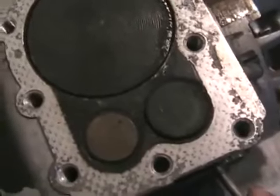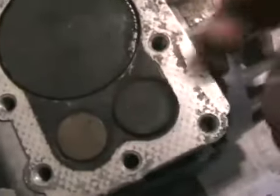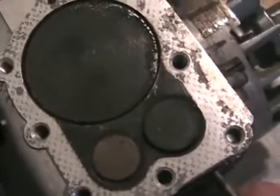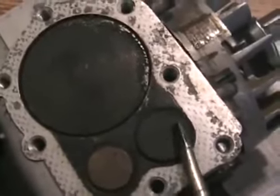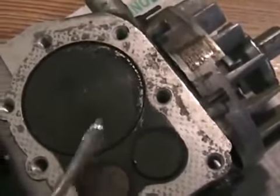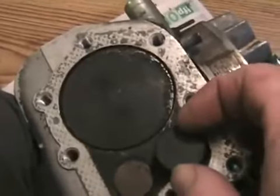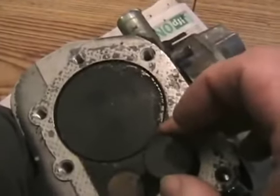Here's what you're looking for. When you're opening and closing the valve, the valve is perfectly straight when it drops down to the closed position and doesn't shimmy sideways at all. If you still need to bend it, it'll shimmy sideways. Even though I'm opening and closing this valve, you can see that it's pushing itself a little bit in that direction — so that means you stick the screwdriver under this side and bend it more in that direction. Then you try it again. When you finally get it going up and down where it just lands and sits square every time and doesn't do a little shimmy in any direction, then it's straight. Believe me, this really works.